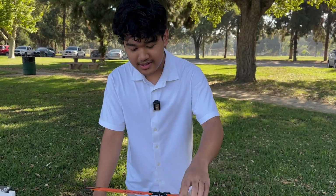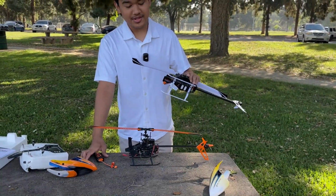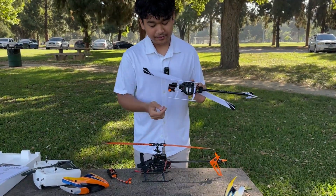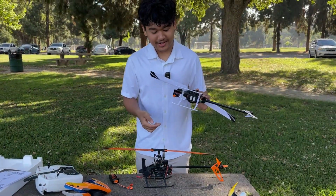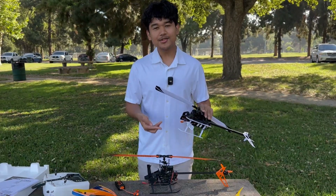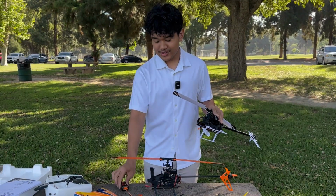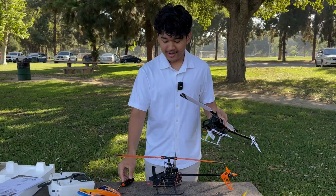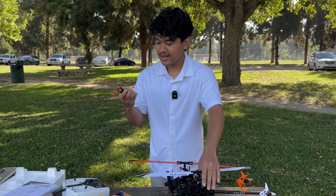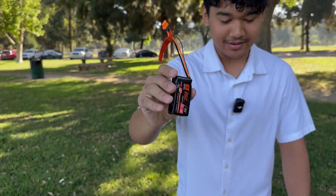But also, these IC2 connectors are always a little annoying because what Spektrum has done is you can literally only use IC2 batteries on this thing unless you chop the connector off, which puts me at a dilemma because I have IC2 batteries, but I also have XT30 batteries I want to use. You can't use an XT30 to EC2 adapter because EC2 is not compatible with IC2. So you're really just locked into the Spektrum ecosystem here unless you pull the plug and solder on something new. But we have batteries and they work fine. These are 3-cell 850 milliamp hour 30C batteries without a balance plug.